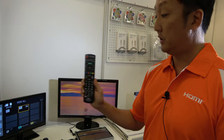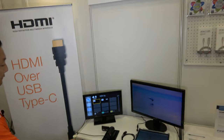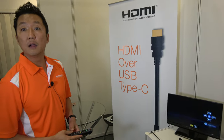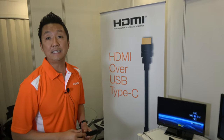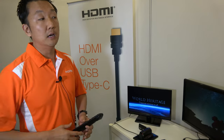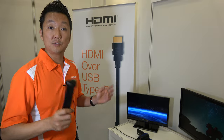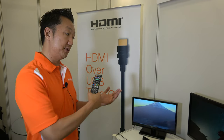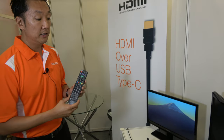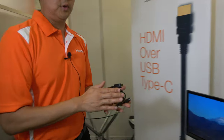Additionally, I can use the remote control through what's called HDMI CEC — Consumer Electronics Control. That allows full control over the connected unit. So this TV remote is now controlling the camcorder — I have full control over the menu system and can play, pause, rewind everything. HDMI CEC is a standard available on many HDMI displays and devices, allowing you to control all devices with a single remote — your TV remote, Blu-ray player remote, or set-top box remote. That single remote can control everything, and it's also supported over USB Type-C.